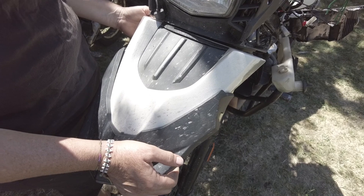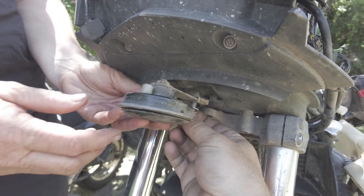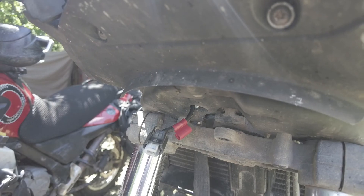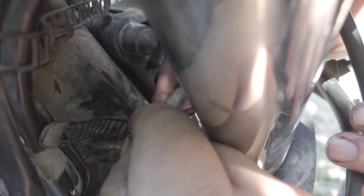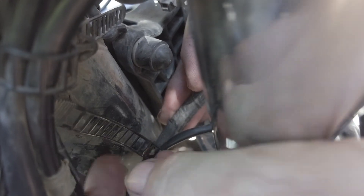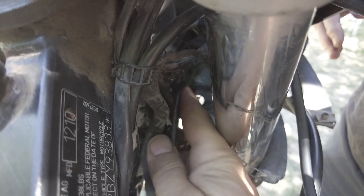In order to get access to the horn lead, we had to pull the front nose off the bike — there are four Torx bolts. One Torx bolt holds the horn up to the frame, and then you just pull this connector. There'll be one more connector right here underneath this switch — that's quick and easy. Most of the other zip ties are standard, but there's one that requires you to push in these little knobs to release it. Just a little patience and you'll get it out. Push the wire through the little hole in the bottom for the horn.